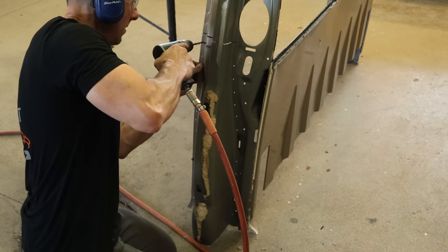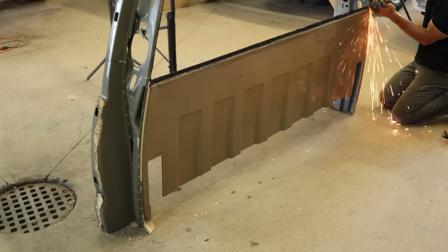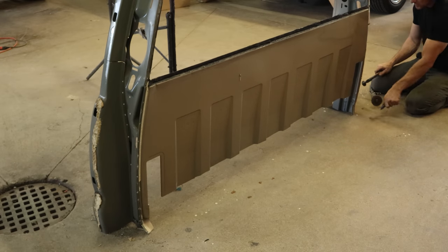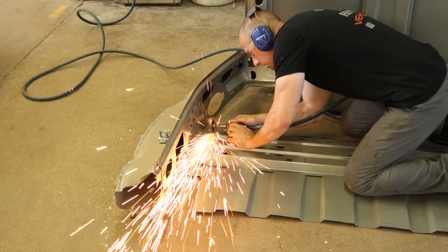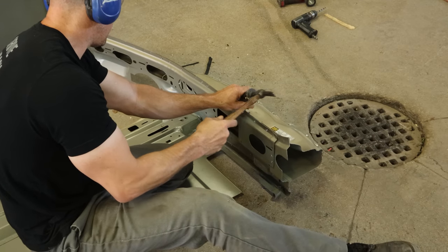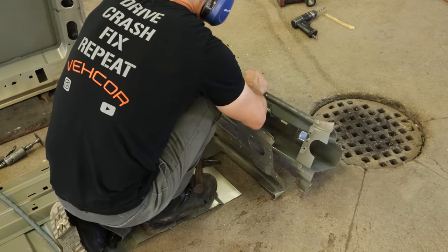Cut through our outside piece and then drill off our spot welds. We're not going to knock that piece off just yet because this piece is kind of big, awkward, and flimsy. So if we leave those pieces in there it makes it a little easier to work on. So now we're going to grind off the back of our cab panel here, get it loose and lay it down. We do have a cushion underneath the back of it so we don't dent the roof. Sometimes a little planning makes your life a little bit easier — that's why I didn't rip everything out right away as much as I wanted to.